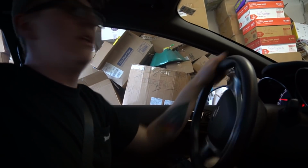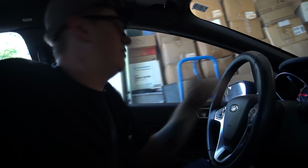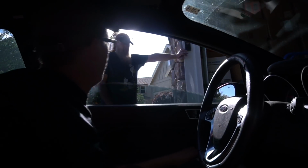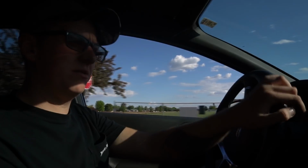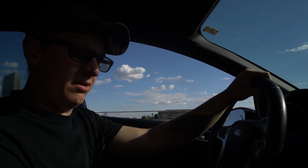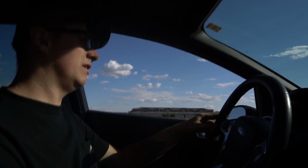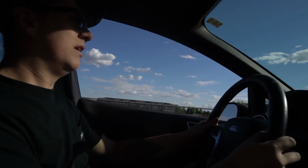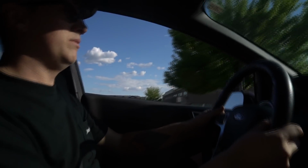God, it's really weird. You know, you get that gratification after you finish working on a car, but it's weird for it to be this one. It's the first time I've worked on a car then been paranoid about being clean before I got in it. Make 6 to 10 stops from approximately 30 to 35 miles per hour applying pressure. Make additional 2 to 3 hard stops from 40 to 45. Alright. I think we got an ST.